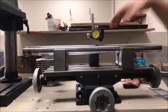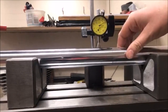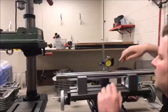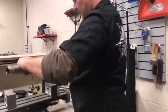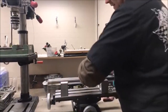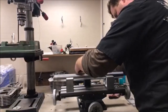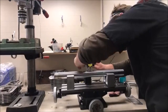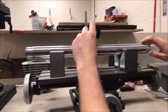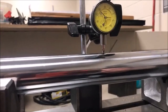I'm going to take this with very minimal effort, let the weight of everything settle. We have another student's fork here - his has around five to six thousandths, I think closer to five. I want to prove a point and show you how fast this setup is. Here's the worst one that has the actual physical damage. I'll square those up - if it's twisted, that raises the reading - let's square that up. Let me set up the equipment, preload that, slide this in. I need to make sure this dial indicator has enough travel.